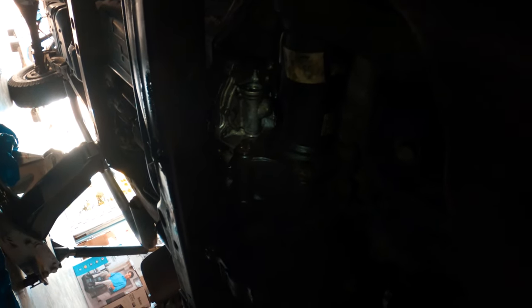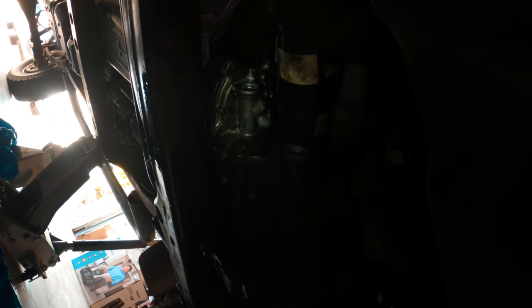Now, this also applies to when you're stuck in 4-wheel drive. Again, I say again, if you're stuck in 4-wheel drive, this will likely be your culprit. If the case is that you can hear the rear of the transfer case go on, it'll make a whirring sound. It sounds like electricity turning on, okay? So that is my case. As the situation dictates, it may be the transfer case. You may have to clean the transfer case actuator if nothing else works. But before you go and blow your money on parts, which are very expensive, clean it first. Unplug it, put some mass airflow sensor cleaner on it, and then go ahead and try it again. If that doesn't work, then you likely have a bad actuator.